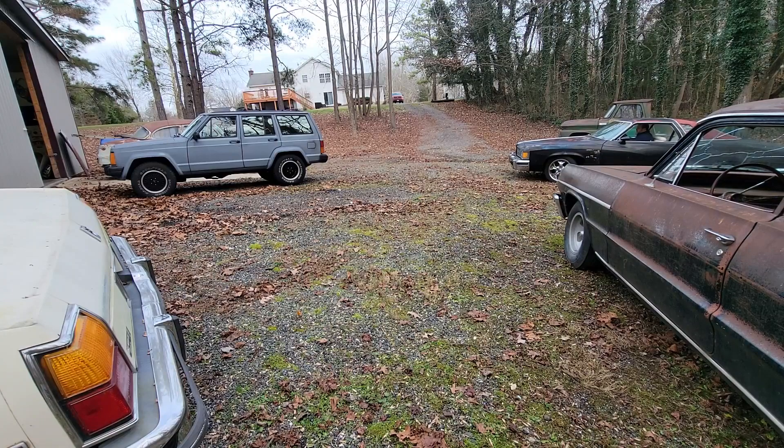So now you guys watched that and saw some of my thoughts there. What do you think the first thing I did wrong was? It's pretty simple guys — I kept looking at other spots. We had no problems with the car right, the car was running great up until that heater hose blew. Not a big deal, it happens. I swapped it out and it kept leaking and overheating, and then I started chasing everything else. I should have gone right back there because we had zero problems until that simple thing broke.